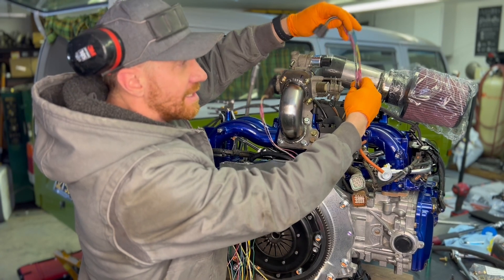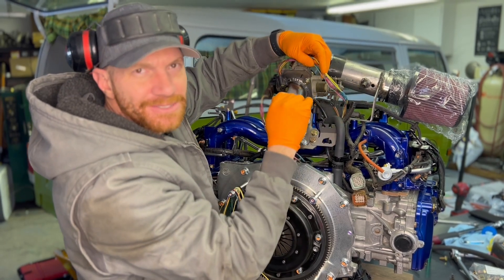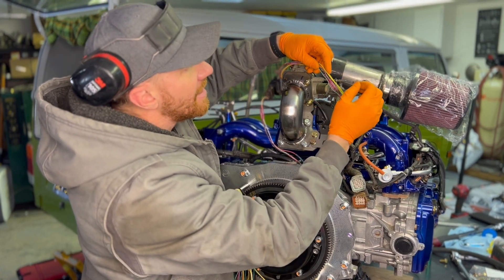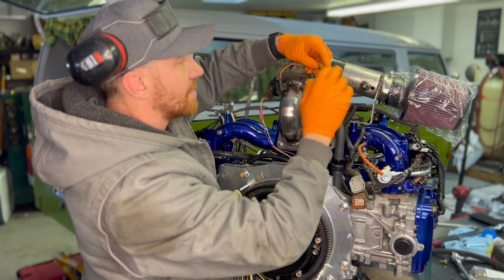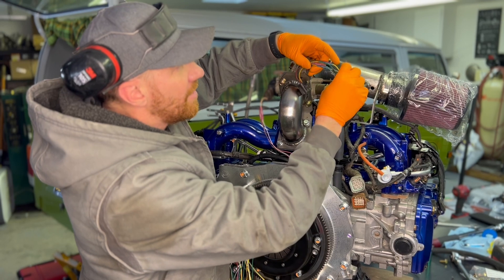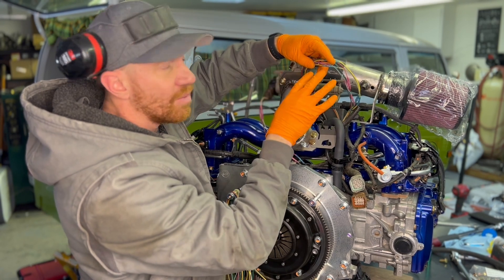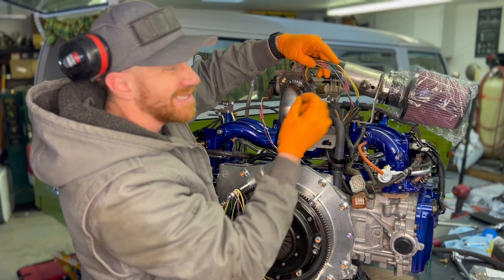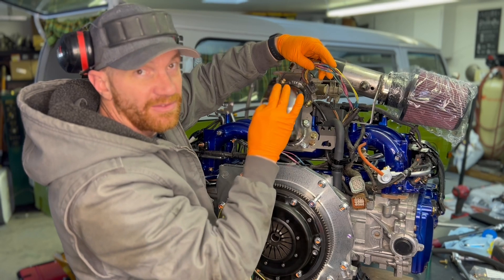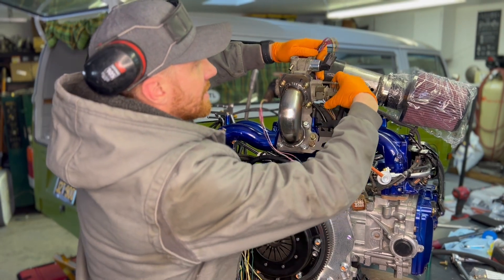Another quick tip — it's just the way you do things. These bigger gauge yellow wires go to the fuel injectors and elsewhere, and they're important. You do not want to splice in wire that is ever smaller in gauge than the wire you already have on there. The wire I spliced in is actually a touch bigger in terms of gauge, and that's fine — bigger is okay, a touch bigger is okay, but smaller is a definite no-no. Then I can tie this back out of the way of my throttle actuation.